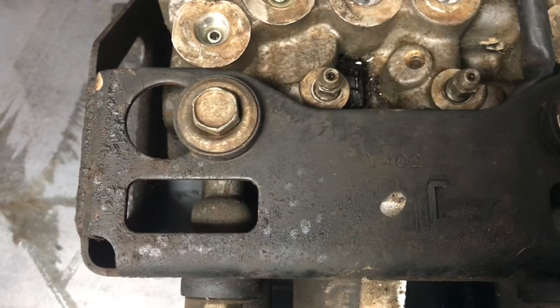I hope that helps you on how to bleed those — I know they're a pain to bleed. Some say you have to go to the manufacturer and have them put it on a scanner. This requires an OBD1 GM Tech One to pulsate the motor and push the air out. Another way is if you go on a gravel road, dirt road, or mud and hit your brakes — let the ABS activate and it'll push the air through the system. You'll probably have to bleed your brakes one more time, but it's another way to do it if the brakes feel spongy.